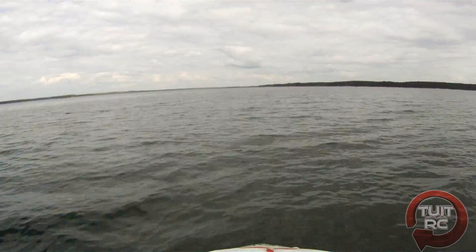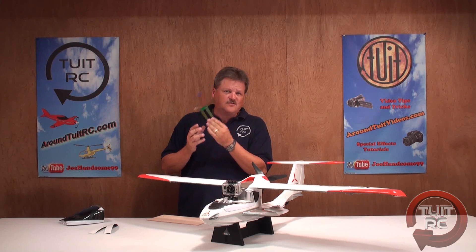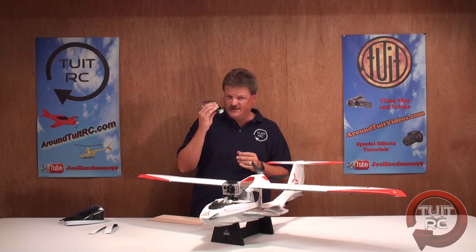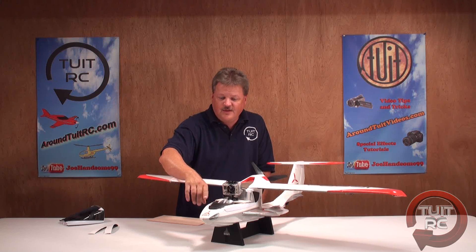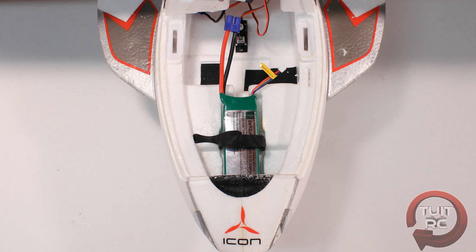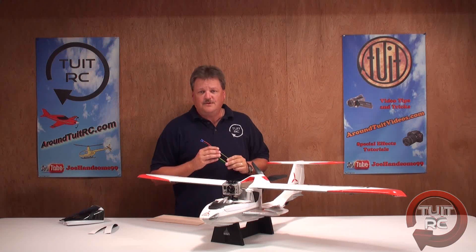Now let's talk about the battery placement. Remember, you need to put some hook and loop material on the battery — it's totally optional as to what you put on there, hook or loop. I like to put loop material on all my batteries. Let me show you the original position of the battery first — that's the way it would normally go right there. Now with the GoPro Hero camera mount on it, you want to put the battery in this position. This is what worked best for me and I had some really good flights that way, and it's a good starting point for you.